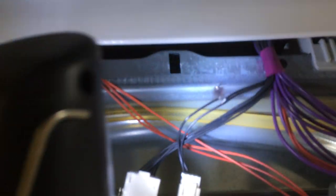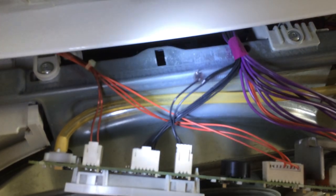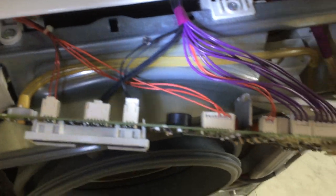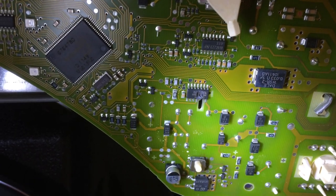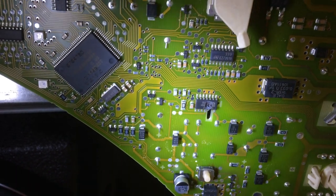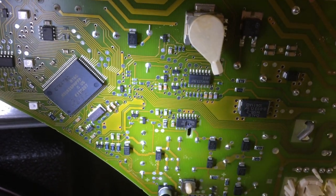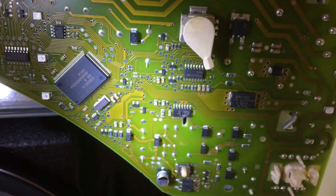The first thing I saw was this burn mark here on the chassis. This wire had arced over, obviously causing the burn mark — it had worn on the edge, so there's no protection on these cables at all. It's pretty poor, really. Shame on you, Miele. That fault then resulted in one of the ICs going open circuit — in fact it's blown the top off it. Looking on the internet, many other people have suffered the same fault. The chip, I think, is a TEA1522, and that clearly needs replacing.